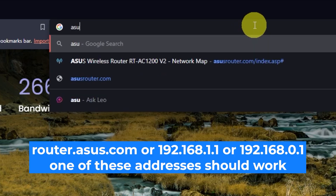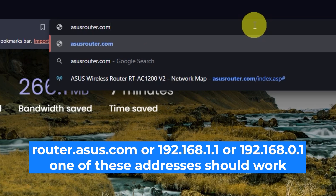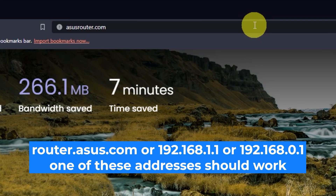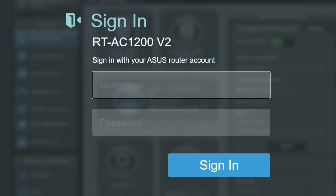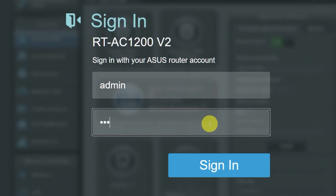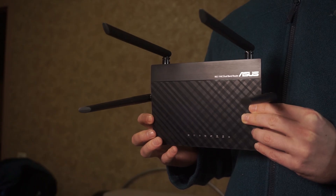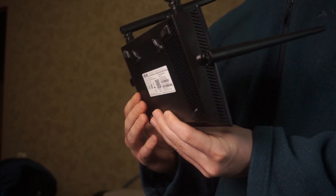Great, you've connected to the router. Now let's start setting it up. Open your web browser and visit the URL you see on the screen — use the URL bar instead of the search bar. At the beginning you will see a form with a login and password. Usually it is admin and admin. If these credentials are wrong, find the label on your router — the credentials are often printed on the bottom of the device.